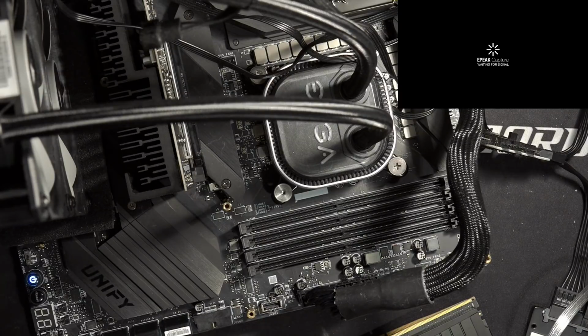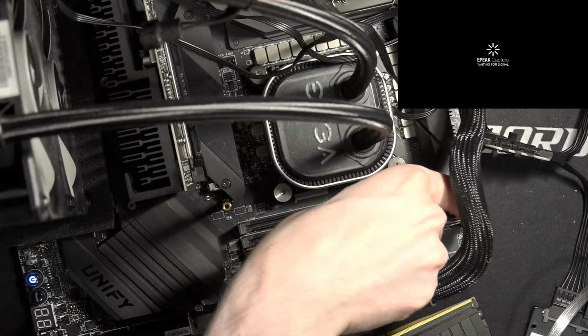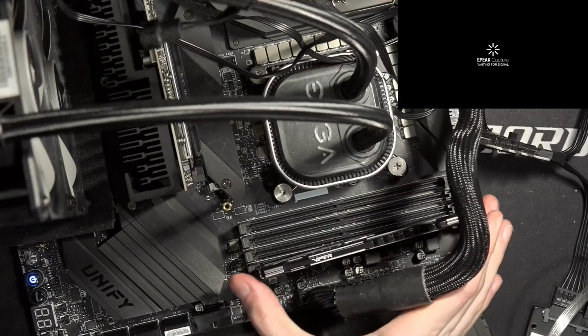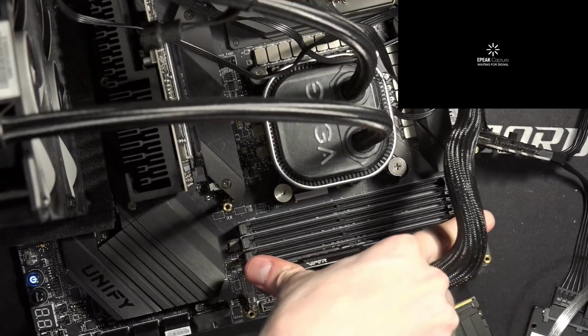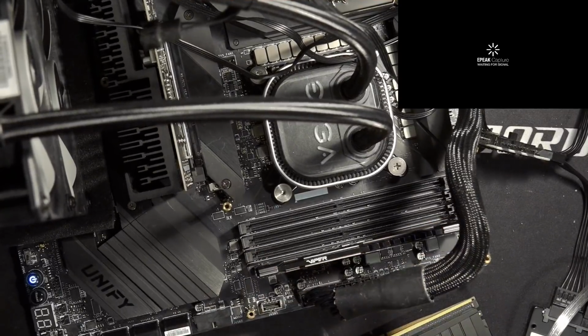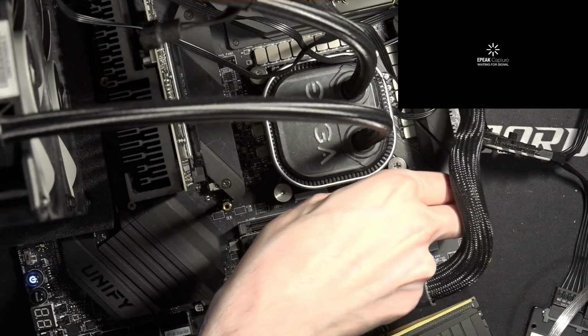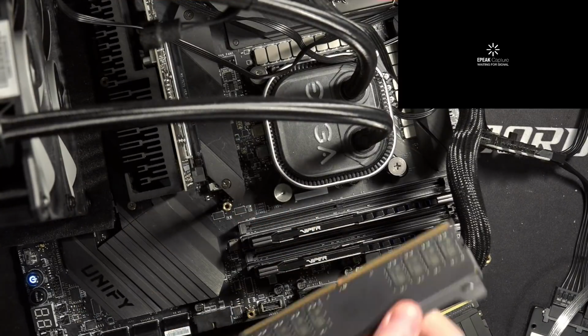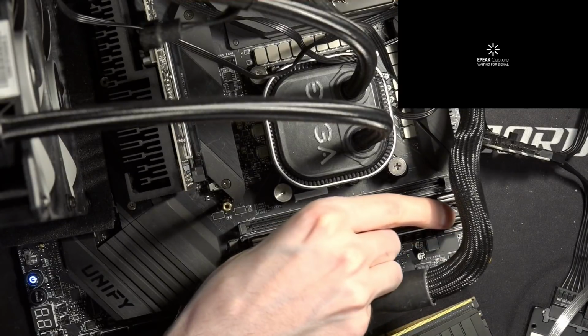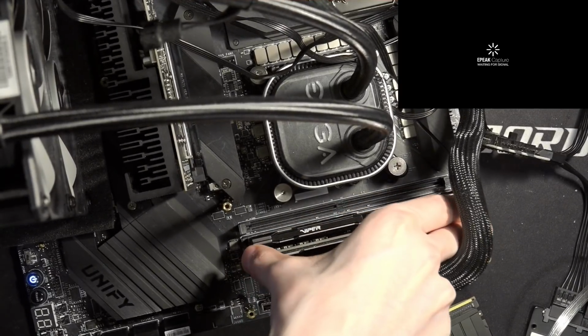But it's still also fair to say you can have a dual rank DIMM, and then the memory controller is going to run your memory configuration in dual rank, or you have single rank DIMMs, and when you have 1 in each memory channel, the memory controller sees single rank. Because the ranks are per memory channel. It's not like I'm putting 1 rank on one of the 2 memory channels that the CPU has, and another rank on the other channel. So right now, this is single rank, dual channel. Then we add another rank of memory to channel 1, and now that channel is in dual rank.